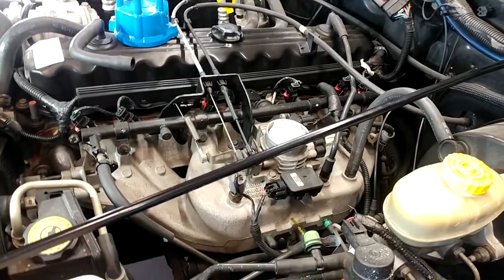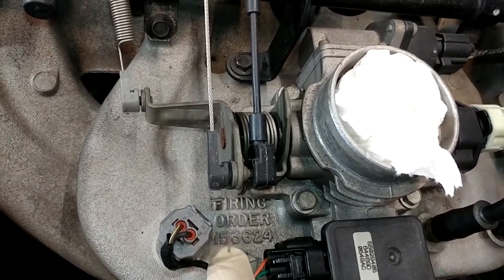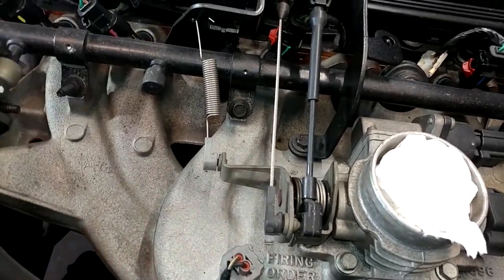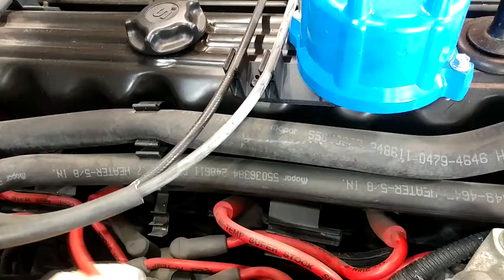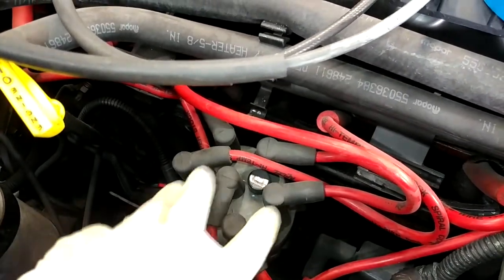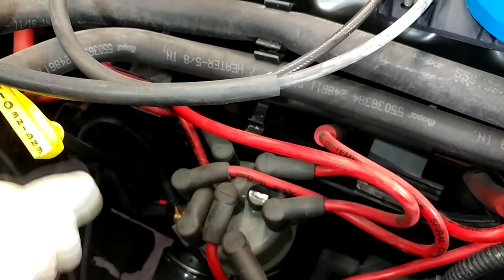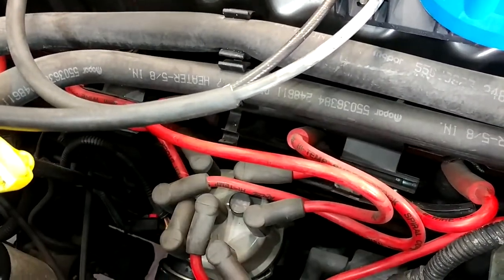When you get parts labeled like this it's nice, but you should always double-verify everything, because on an older EFI car somebody could have dropped this distributor in so number one is anywhere and established the firing order off of that. The second part of our cheat code is over on the intake side of the engine — on most older engines there's normally the firing order cast right into it. This one is 1-5-3-6-2-4. So we know where number one on our cap is going to be, and the next one in line should be five, then three, then six, two, four. We need to verify which way they go around — looks like it's going to be clockwise, so we go one, five, and then on around with our firing order.